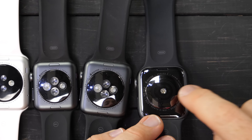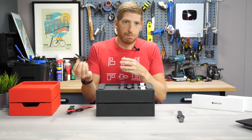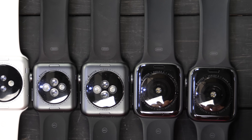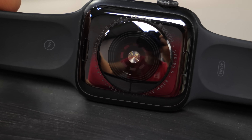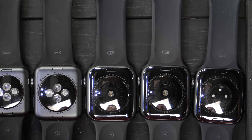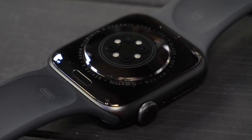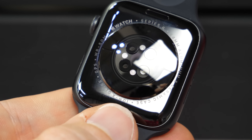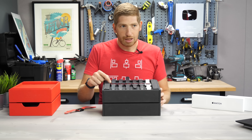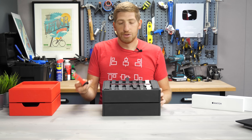The Series 4 has a single central LED cluster — actually four LEDs inside — with photodiodes around the outer edge reading the information the LED pushes into your skin. Series 5 is the same design. In Series 4 and 5 you've got a split outer ring — two half-rings — for the ECG functionality introduced in Series 4. Then Series 6 is completely different: four LEDs, four photodiodes, with red and green LEDs — technically eight LEDs. So we've got basically Gen 1, Gen 2, and Gen 3.